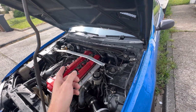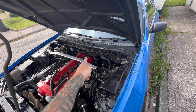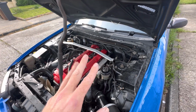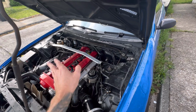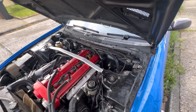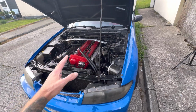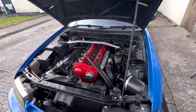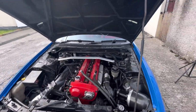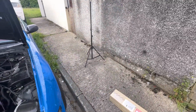If you didn't watch the video, check it out. I got one of my old ignition coils that I should have brought with me, and we wanged that in and the car was fine after that, but it's still a bit misfirey. So they're all old. I mean, those 5 are old, and that yellow one's really old. They were in the car when I got it, so the yellow ones were. So we need to uprate to the R8s. Apparently it's a massive upgrade, which I'm looking forward to, because the car should run a lot smoother.